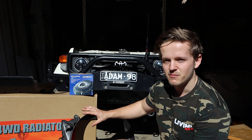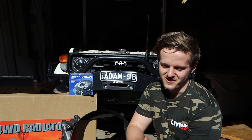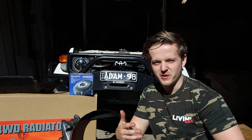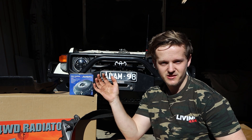I've always had kind of cooling issues with this car when out four-wheel driving, pretty much because my radiator gets filled up with mud — so it is kind of my fault. The other thing is to get a bigger intercooler with thermo fans, and that's probably going to be my next step. But this radiator that's in it at the moment is a little bit stuffed anyway, so it's a very good time to be swapping all of this out and putting something a lot better in.